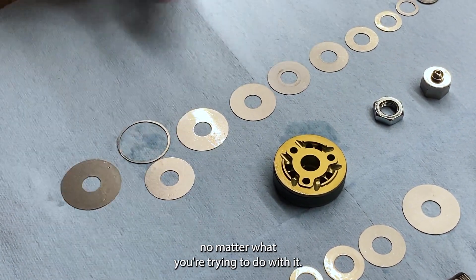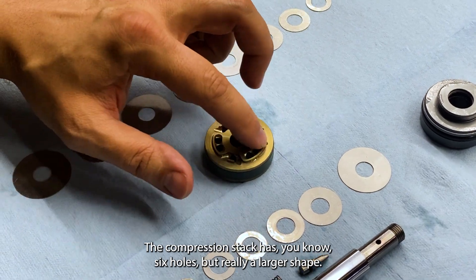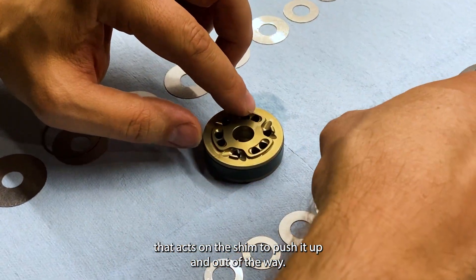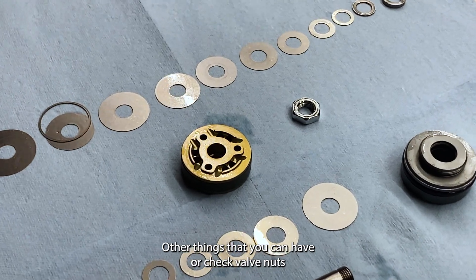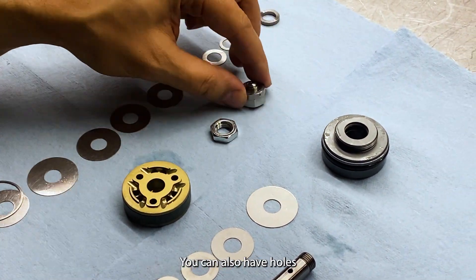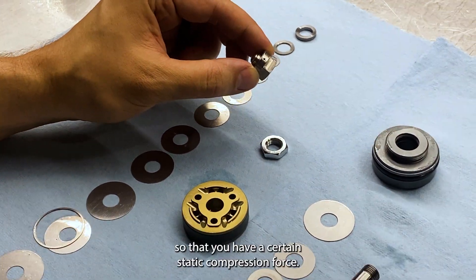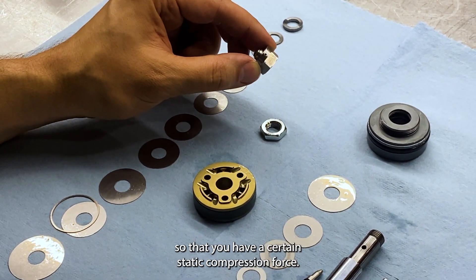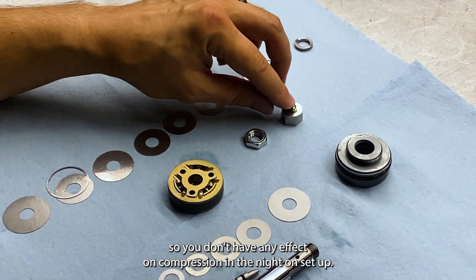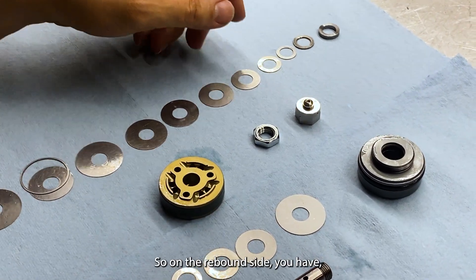You can pretty much do anything with these pistons — you don't have to have specifically a digressive piston. There is a limit to how little linear rate you can get out of that, but usually it's not limiting. It's a well-designed piston with the appropriate range no matter what you're trying to do. The rebound stack has three small holes; the compression stack has six holes but a larger shape — this is the area that acts on the shim to push it up and out of the way. You can also have check valve nuts which only allow fluid to flow one way, or holes drilled in the check valve to allow a certain range of adjustment for a certain static compression force.